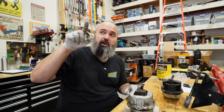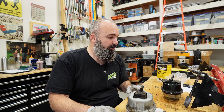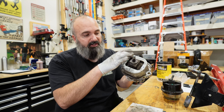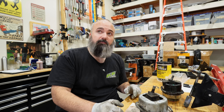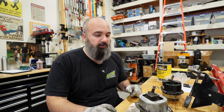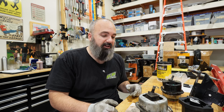These things popped right out, no problem. I didn't have to pull the intake manifold and deal with potential air leaks from breaking the PCV lines, which are known to be fragile with time. Lesson learned — I should have done these originally. You can see the steel arm or aluminum bracket on the side of the motor was resting on this steel bracket and completely cut the ears off that are supposed to be there. But all told, not a bad job. If you were doing this on jack stands, it'd be a little tougher — you'd have to use jacks to support everything — but totally doable nonetheless. Thank you for watching. Stay tuned for part two — in the next video, we're going to try to install the transmission mount without the special tools, a little backyard mechanic shade tree stuff.